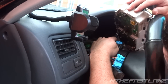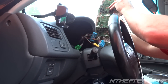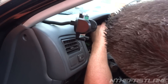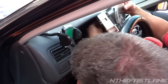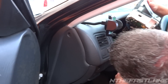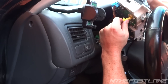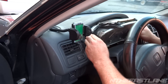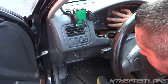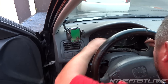We're going to put the front in like this, curve it back just a little bit, then come in here and plug these plugs in. The two blue ones go in the top part, then we got the yellow one — the yellow one just plugs in right here. Now we just gently slide it back in, first at an angle with the bottom first, then line it up just like that and put all four screws back in.